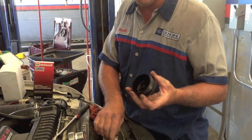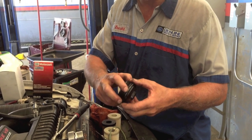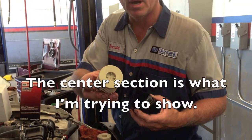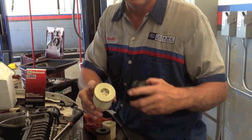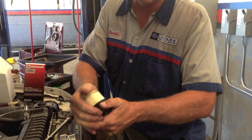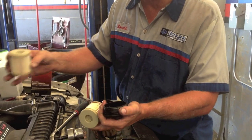It's pretty straightforward — I just take the O-ring off the old one, remove it, take the new one, set it in the proper groove, put it on there, and make sure it's not rolled. I'll usually just use the fuel as a lubricant. Now, if I'm using the genuine Ford one — also the AutoZone ones look like the same people make them — the AutoZone ones are pretty good quality. But if you have the genuine ones, I fit the O-ring onto the cap before I put it in because it's a snug fit, so I don't damage it. With the aftermarket ones, they really don't go anywhere, so you can stick it in first.